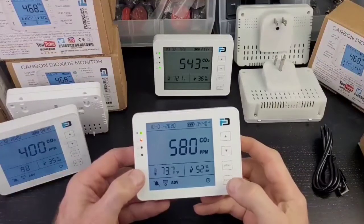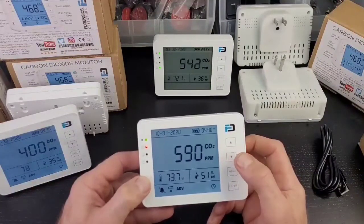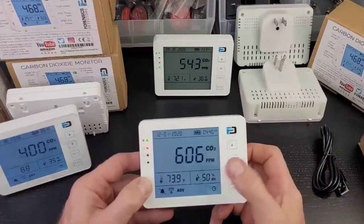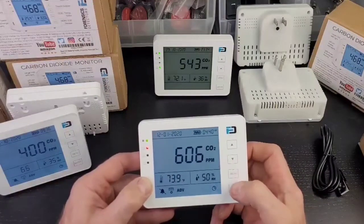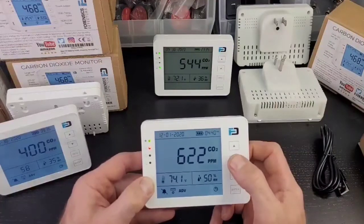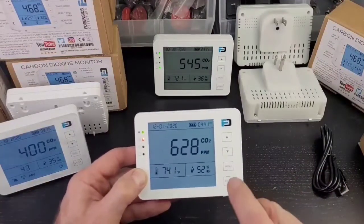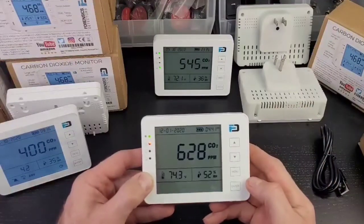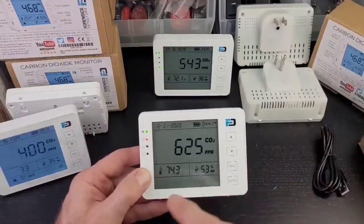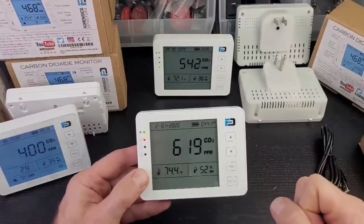The next functionality is changing the time. Go to the clock, press enter, then scroll through the digits for date and time. To change a value — say changing 10 to 12 — press enter to engage edit mode, adjust the value, then press enter to lock it in and move to the next field. Always press enter to get into edit mode before making any change. Press menu to return to the main screen. So we've covered calibration, alarm levels, muting, and time settings — that's all the functionality this CO2 monitor from Forensics Detectors has. Be safe, be well, and happy days!